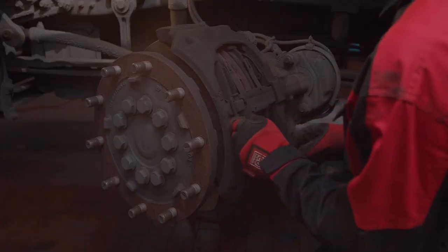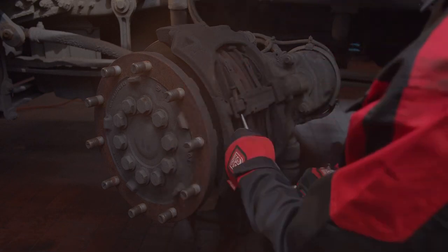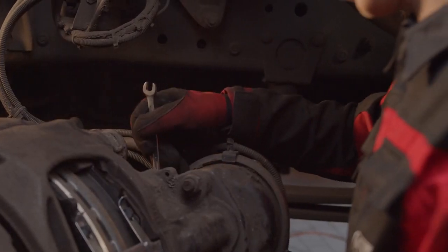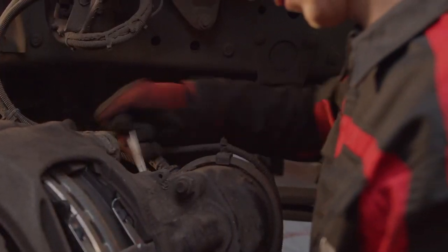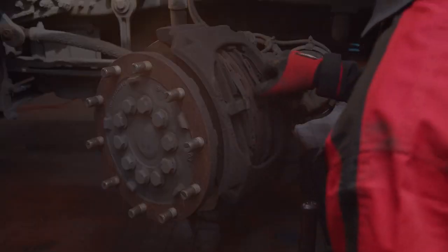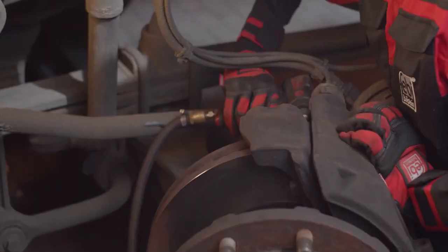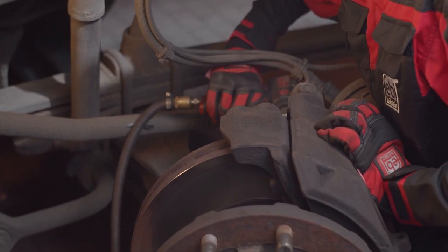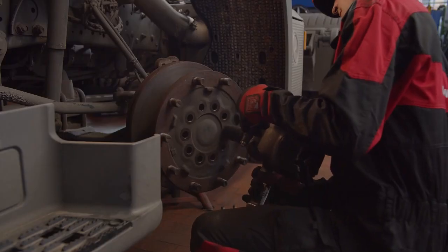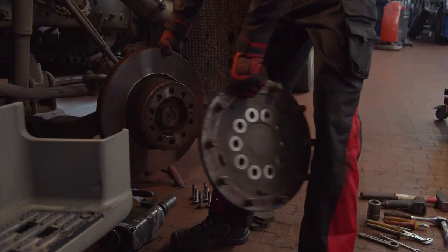Before the brake pads can be removed, the cotter spring, washer, and the pre-tension retaining bracket have to be removed. Now the brake adjuster has to be turned counterclockwise with the hexagon adapter until the brake pads can be removed. After the brake pads are removed, the brake caliper and brake retainer can be removed. Loosen the hub bolts and remove the hub plate and the old brake disc.